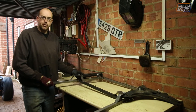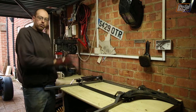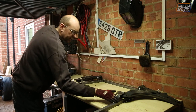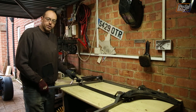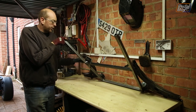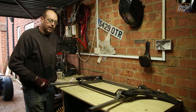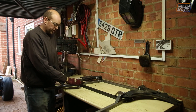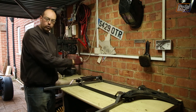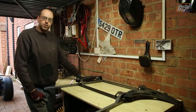This is our newly completed replacement chassis — it replaces the entire bottom at the front end. It needs to be a bit longer, but we'll deal with that later. The main thing we've added is brackets on each side, because the back of the suspension is held on with a through-bolt. Whilst we can bolt all the way through the bottom and out the top, it still allows a little bit of play, so we've added these structures which have the bolt going through the corner, stopping it moving around at all. This is now really solidly located, or at least as much as it can be in a rubber bush.